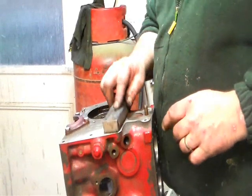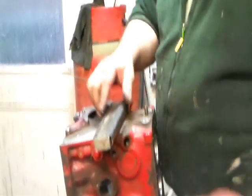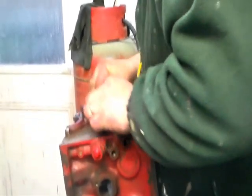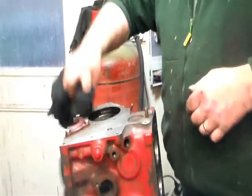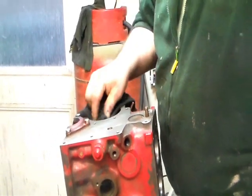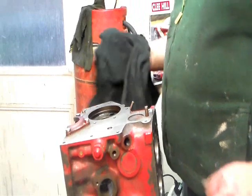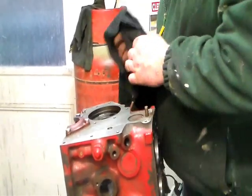This is all about making sure this motor doesn't have to come out through anything I've done, or not done. That's why I do it. It might take a bit longer, but I've never had to pull an engine out through anything I've done before and I don't want to start now. You can see why it's a must that these engines get washed afterwards. I always like to run it up with fresh oil, run it for five or ten minutes, then dump the oil out and put another fresh load in.